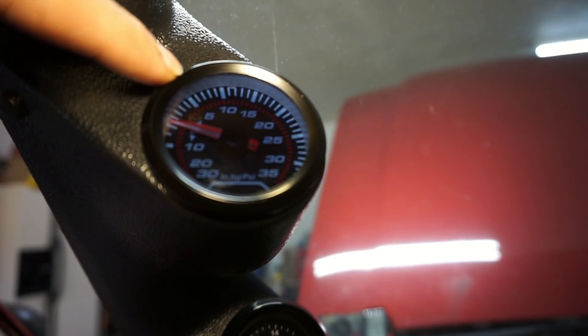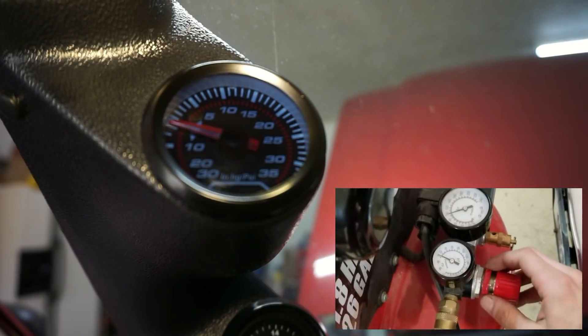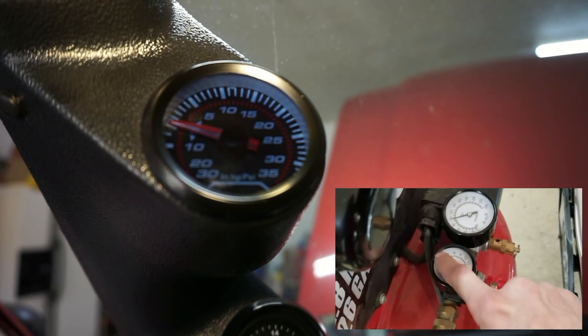So I'm going to turn the pressure up, and when it gets into the 5 to 10 range the buzzer is going to be kind of intermittent. I'm going to record with a different camera over on the multimeter and actually watch the numbers to see if it says open load or not — it might just be the buzzer not buzzing properly if it still has a connection. We're going to do both and see how it works. I've got 100 psi in the tank and this is going to go up to like 65.